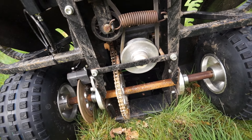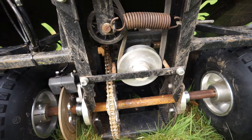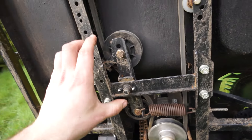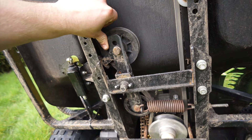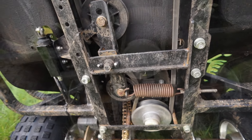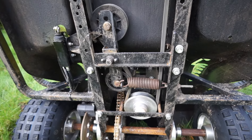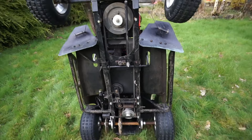What we found is we need to gear the whole thing down. It was hitting 50 miles an hour in the field, which was great, but for smaller, tighter, technical tracks we need a little more grunt low down. There's the big clutch — stock clutch was a little flimsy, so this is built out of four-millimeter thick angle iron, chopped and welded together. Build it strong and it pays dividends. In there we have the T-drive from Ron's Bits, and it kind of hides in there and transmits the drive from that plane to this plane. It's really that simple.